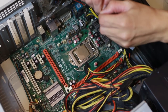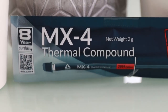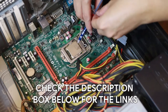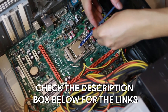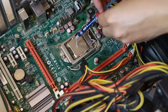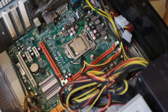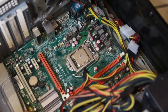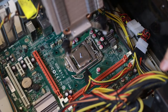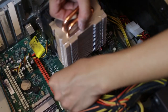Then I will put a new thermal paste. I bought Arctic MX4 thermal compound for this one — I will put the link of the products in the description box. Usually I just put a pea-size amount of compound, just a small amount like this. How about you — do you think this is not enough? Tell us how much thermal paste you put in your rig, comment down below!